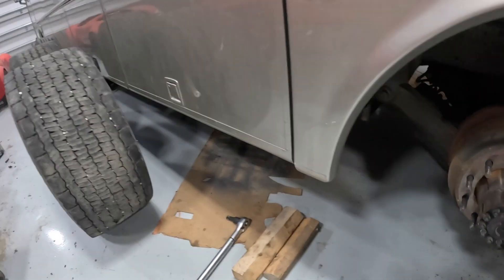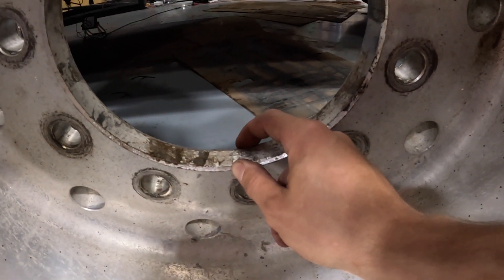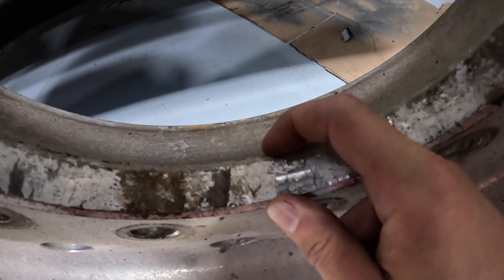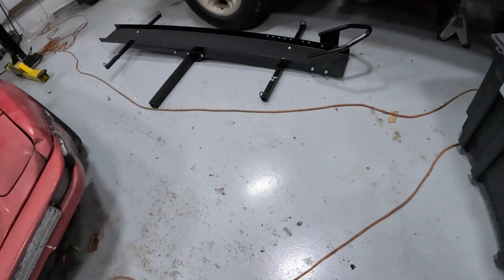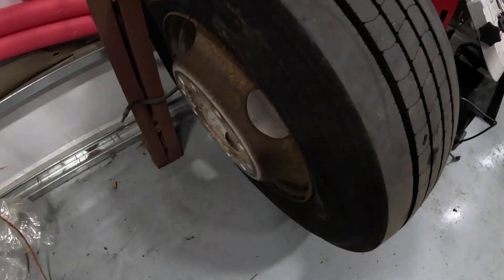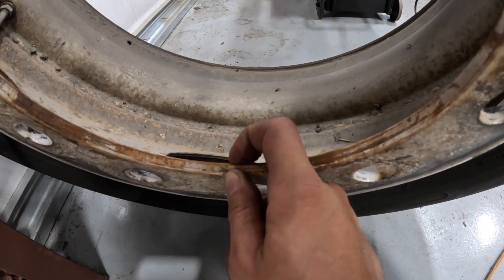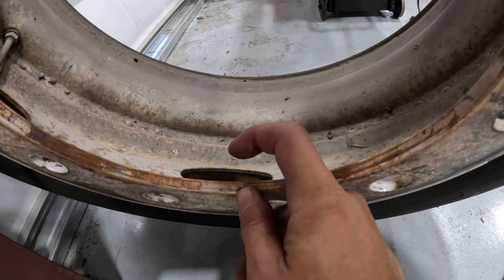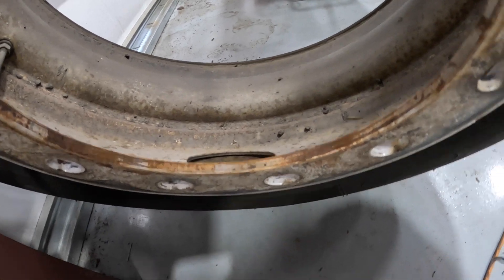If you're doing super singles, you're going from a dual setup to a single, so you'll have less thickness. This had an aluminum wheel in front and a steel wheel behind it — that's really common on anything with duals, because aluminum wheels are more expensive and steel wheels are cheaper. If you do go to double aluminum wheels, you need to make sure your studs are long enough to accommodate that extra wheel width. The aluminum wheel is considerably thicker than the steel wheel.